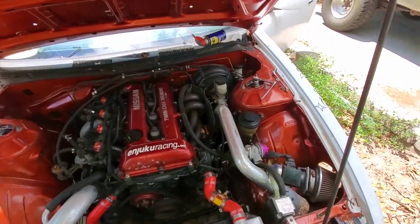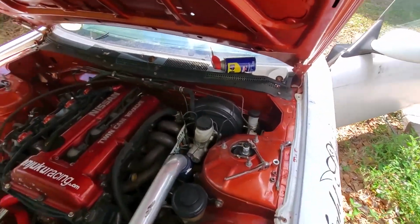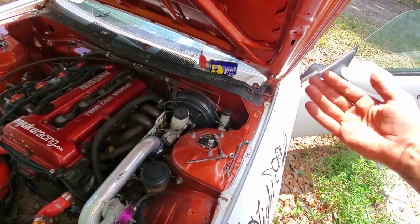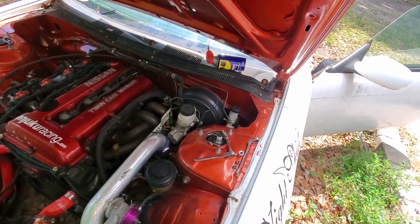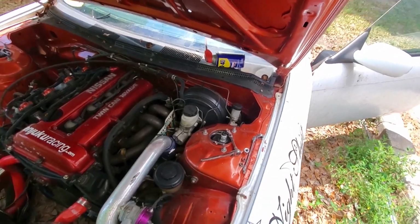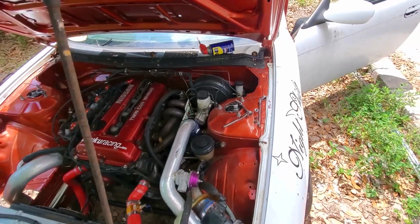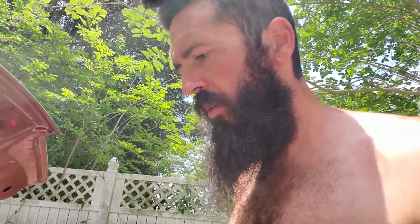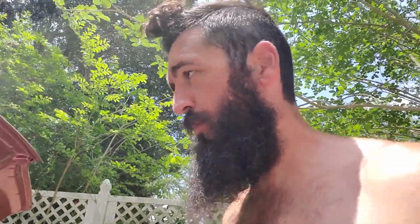Now, the big thing that was holding this up from really driving was the clutch pedal was losing pressure. You could pump it up, sort of, enough to get some pedal out of it, but it wasn't holding. So I'm pretty sure it's a seal in the master cylinder, by the cup or whatever, and it leaks past when it sits. Anyway, a new one of those is coming today. Austin's going to slap that on in a little bit, and then we should be able to drive it.